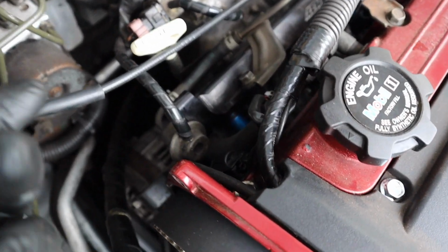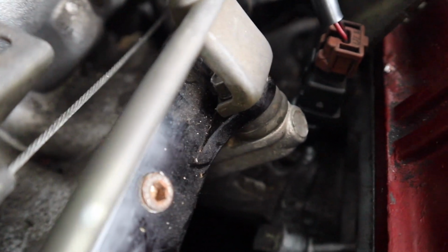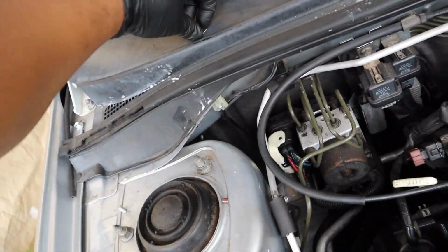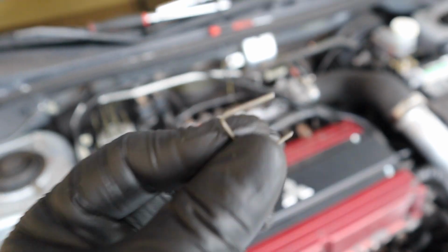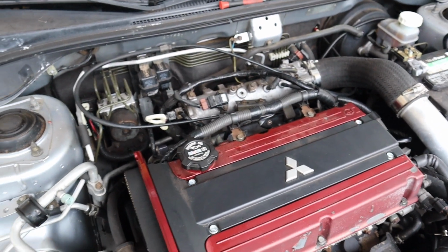The injectors are installed with the adapter plug. Everything plugs in the way it needs to. I lost the black spacer on the fuel rail on top of the intake manifold, so lucky thing I had an extra rubber spacer with the insert in there, so that's pretty nice. And one of the clips fell off, or flew off somewhere. It goes onto the injector plug and keeps it in place, but I got super frustrated and didn't want to spend time putting it on. I think it should be okay, but for now we're just going to ditch this.